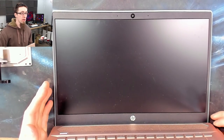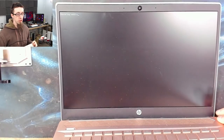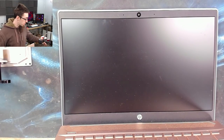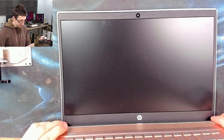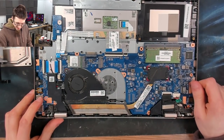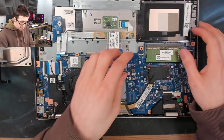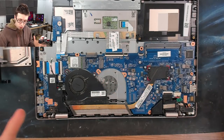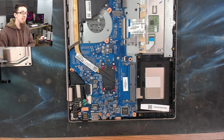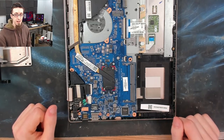That was throwing up some weird BIOS messages, probably because we had a clean BIOS image on it. What I'm going to do now is flash the original BIOS image back onto it. It looks like that was it — it was bad contacts on the memory. What I'm thinking is: the previous attempts where it was starting to boot went straight into those flashes. This time it clearly did RAM training. Previous times it didn't look like it was doing RAM training — but if it didn't have a connection to the memory module, of course it's not going to RAM train.